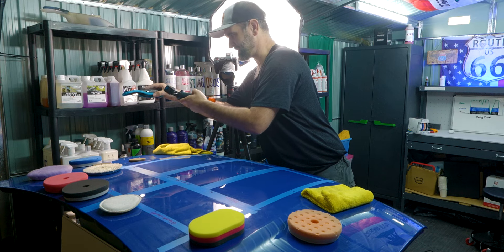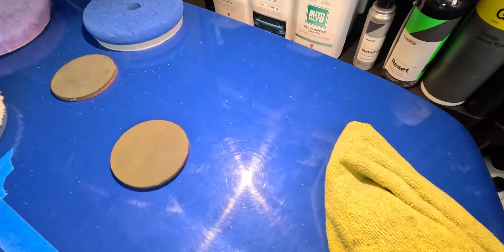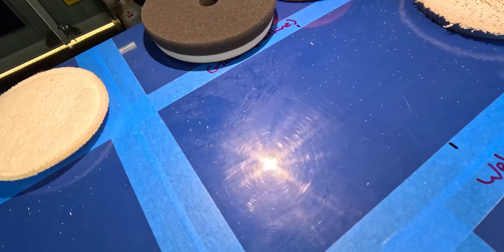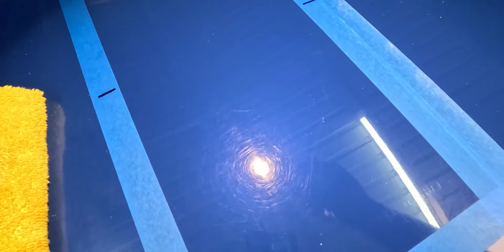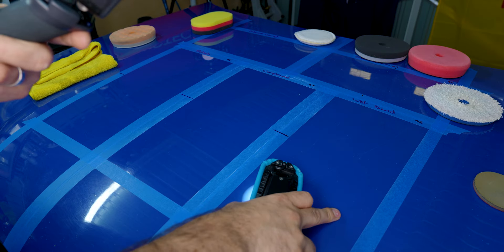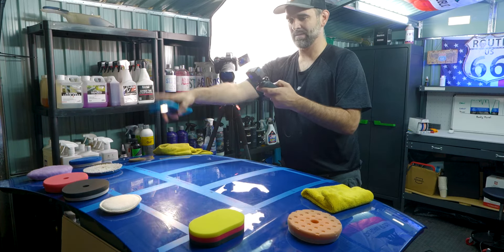So here then - this is how the paintwork was before. Onto the wet sanding section - you can see all these swirls no longer show after wet sanding, but it's all flat and rather dull looking. I've got a few swirls here; I could have worked the polish a bit more - normally you'd do two or three steps. But just dropping it down, you can see the improvement from the compounding stage. Then with polishing, you can see it doesn't remove a great deal of swirls but it does refine and add gloss. Holding the light further away, you can see it's glossier than the compound stage, which is clearly glossier than the raw state.